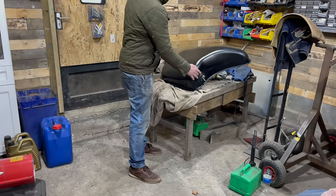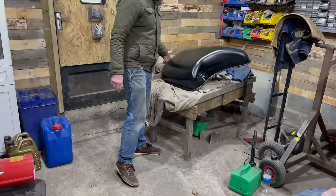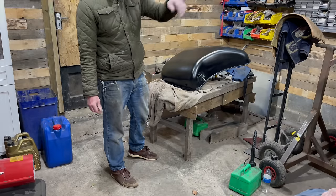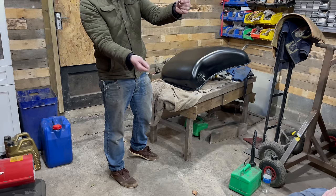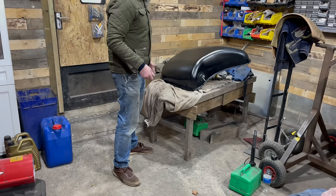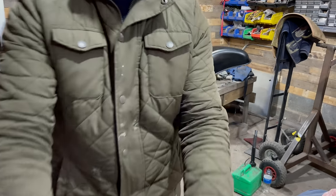And then I just took the level out the back, for emptying it out the back, and I put that back in. We tested that on the car and made sure that the gauge works and the car works lovely when you're on the gauge. We just literally plugged the gauge in and lifted the tank unit up and saw the gauge works and the car works great when it was out of the car. So we're kind of ready to put it back in, so I'll give you a closer look around the tank, what we've done.